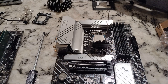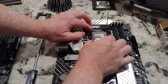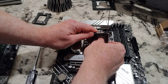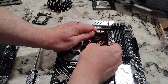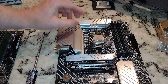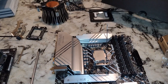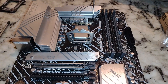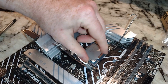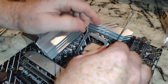Alright, so you saw I had the cover on. In my opinion, you can take the cover off now or do this — let it pop off. Hopefully it'll pop off. This one's not popping, so manually pull down here. If you're buying it new, it'll pop off. Before I drop this down, you want to make sure your CPU is seated good. The green board part of the CPU should be flush with the outer portion of the socket — and this is in there pretty good. So we'll drop this down.